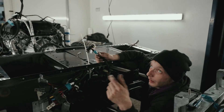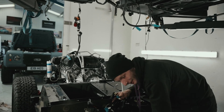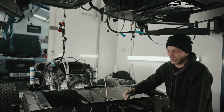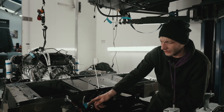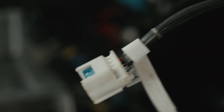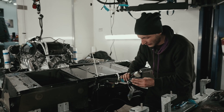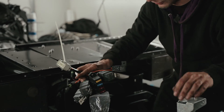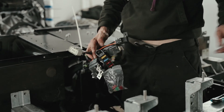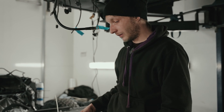By rights, I can just cut this one off and put it into the original one — there's no difference, the plugs are the same. I just change where the pins live and then your original OBD socket is your OBD socket for this. The fuse box for the entire engine is here — that's all it needs — along with the gearbox. There are relays for the fans and for the fuel pump. This is the plug for the pulse width modulation module, which is for the fuel pump — it regulates the flow to the pump, so it doesn't pump more than it needs to, and when it does need to, it's immediate.